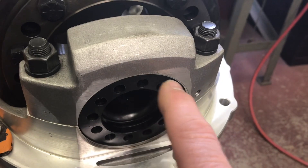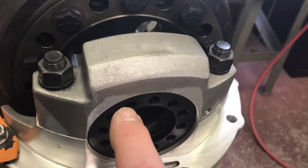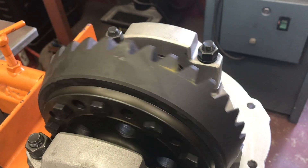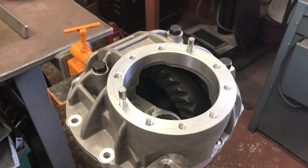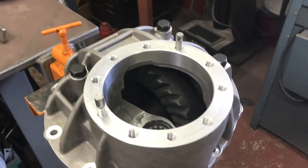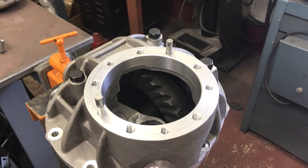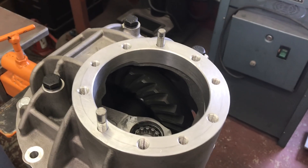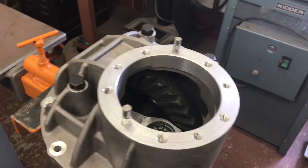These still spin by hand — they're just wrist tight with the ratchet. When I affect moving the carrier, I'll move a half turn on this side and take a half turn on the other side. Right now we're effectively at zero preload. The beauty of a 9-inch Ford is I can pull the pinion assembly out all day long. I've already set the pinion in several times and measured my depth until I came up with 1.024, so I'm pretty sure I'll get it right on the first try with my one shim.